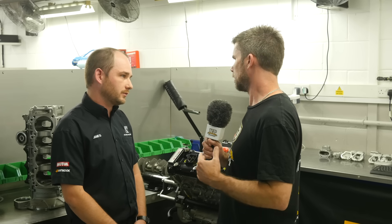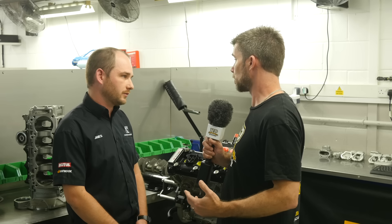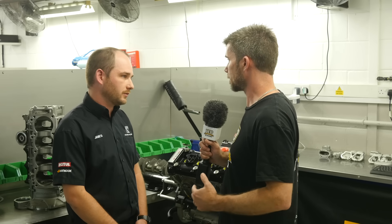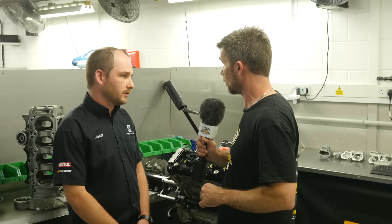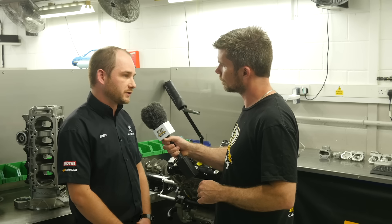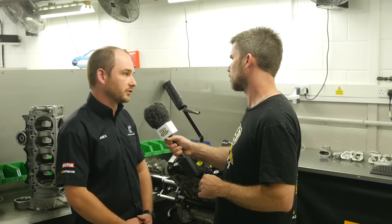In those terms you've got two options: add heavy metal to the counterweights or reduce the rotating assembly weight — piston and conrod. Is there any development in those areas from RPE? We've looked at titanium rods on our larger 3.2-litre applications, and a lot of design has gone into the conrod and piston to ensure they're as light as possible.